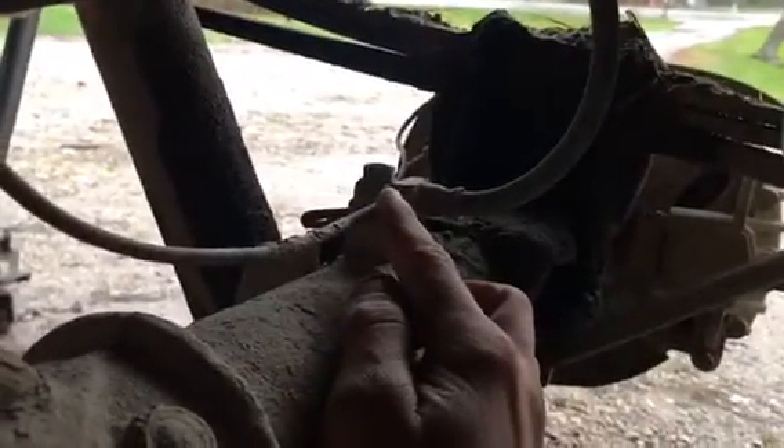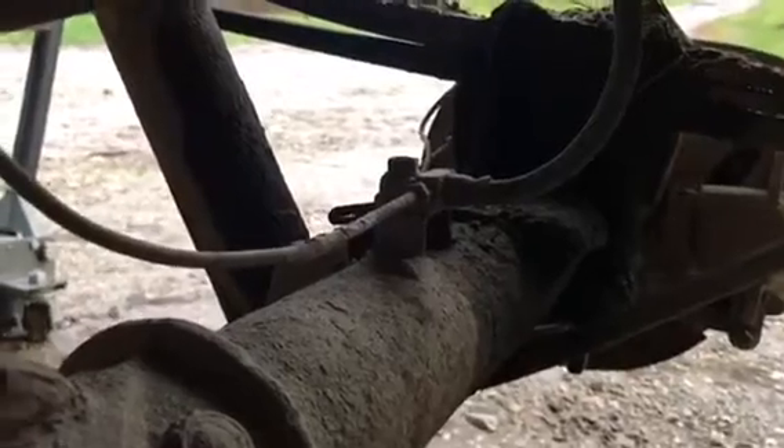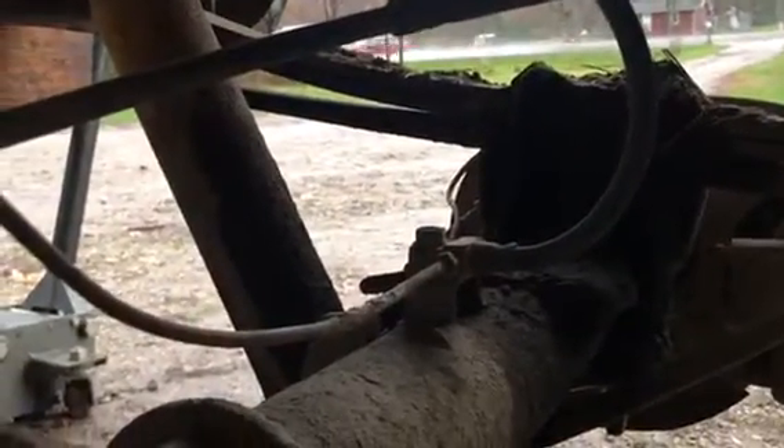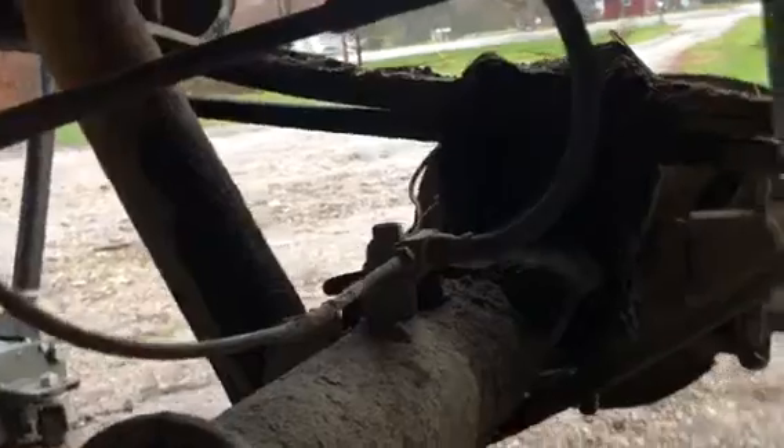My next step - pull the two metal lines off of this valve here, the splitter, and I'm going to put a vice grip right there on the rubber hose coming from the brake so I don't lose all my fluid. And yeah, as you can see I had a bad seal over here - this is all diff fluid, 80-90 whatever gear lube.